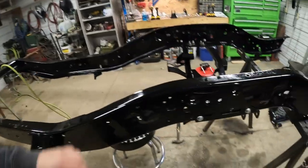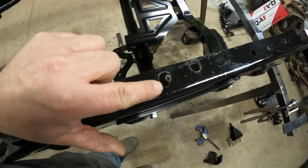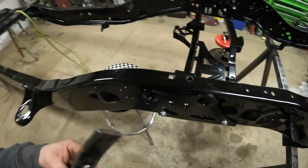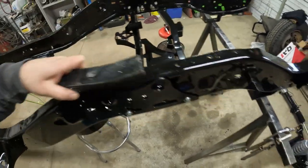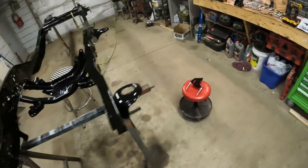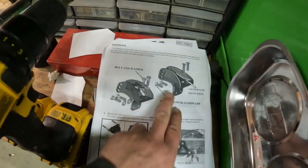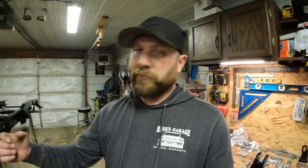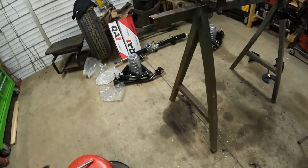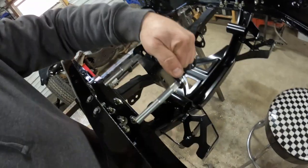We got our top holes drilled. That one is offset in an existing hole, so I marked it and then just took a piece of quarter-inch steel, put a half-inch hole in it, and clamped it over the top to drill through to keep that bit from walking. There's a couple kinds of shock mounts that come with this — a welded steel one and a cast-looking one that might be aluminum. Now we can go about bolting her up — shock mount on the outside, and then there's an inner frame mount that's going to connect everything together. They share bolts, so we'll set the camera up and get her bolted on.